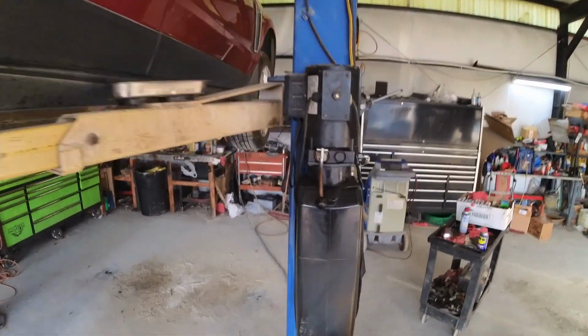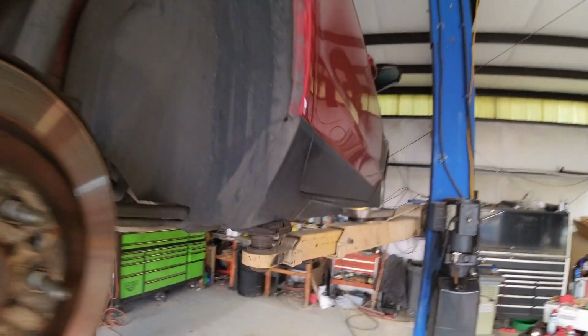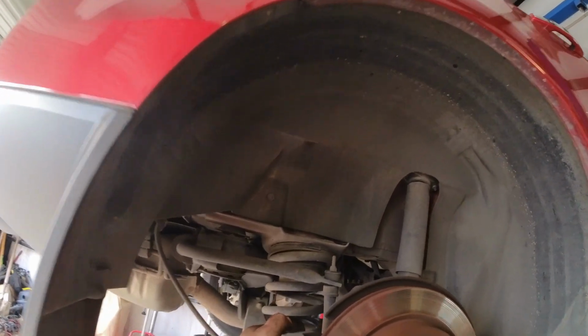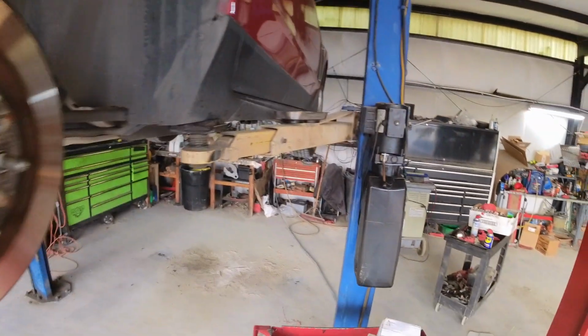Okay. Again, here I try to get this out as a whole assembly. The brake caliper saves a little time. Also, here jiggle back and forth so the piston compresses just a little bit. It makes it easier when you put it back on. Hang this guy up here. And the other ones are 18 as well, I believe.